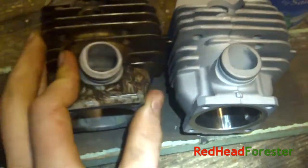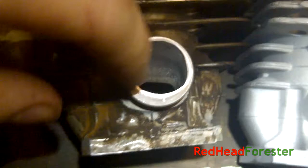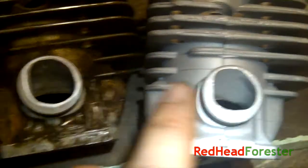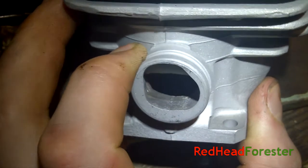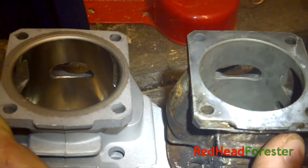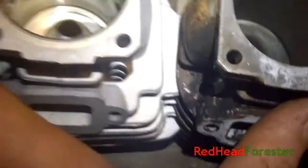Next thing is the size and quality of the intake and exhaust ports. On the Stihl, the intake port is relatively large on the outside and relatively smooth on the inside. On the Highway, the port is a slightly weird shape and a lot smaller than on the Stihl. Additionally, inside — especially on the bottom — it is considerably rougher. On the inside of the cylinder, the Stihl has a wider intake port than the Highway, which is quite noticeably different. So again, I'm probably going to Dremel that a little bit.